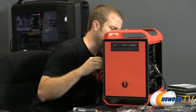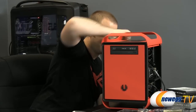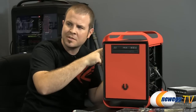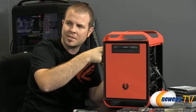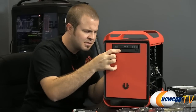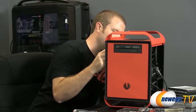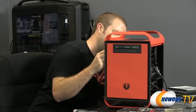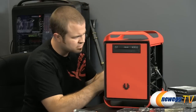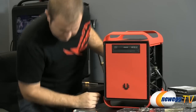See, I thought you were going to say that you can't comment on things that may or may not exist. Oh, well, that's not an NDA, right? Yeah, that connector exists. It's just a matter of if you guys want to purchase it from the OEM and integrate it onto the board. Yeah, the connector can exist, but like I said, it's a power layout issue, so you'd have to lay out your board a little bit differently. We might not want to make those constraints because it could change power integrity or different aspects like that. So that comes through, like I said, as part of our design analysis when we're developing the product design.